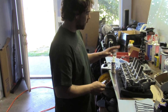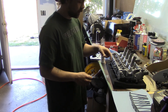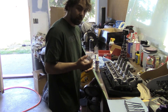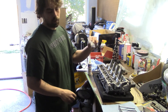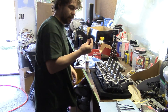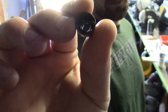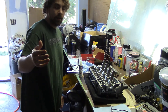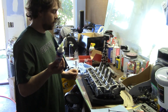We're doing a time-lapse — we removed all the valve seals from the intake side and now we're going to be replacing them. The big thing here is we want to clean all the old debris from underneath, because we don't want one of these seals to go on sideways or crooked. Here's an old one — you can see on the inside that coating is all beat up from removing it, but the same thing can happen during installation and you won't realize it.